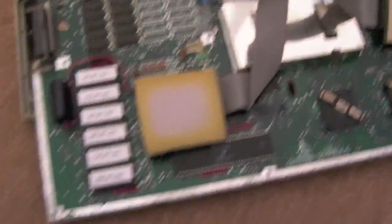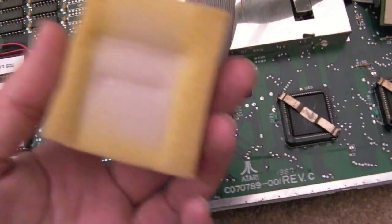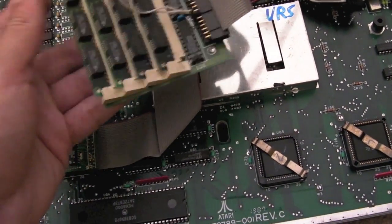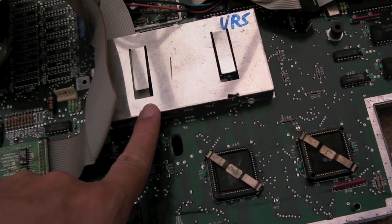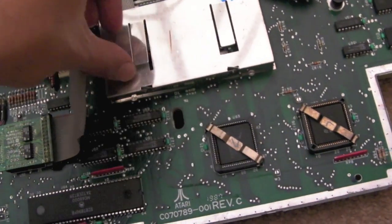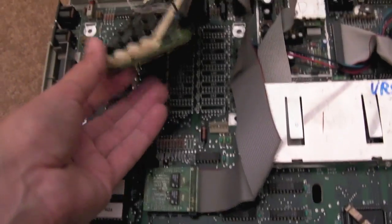One of the first things you'll see is this sponge padding I've put in, which sits nicely under the metal shielding. This is the Marpet — you've got a couple of buffer chips that connect to this PCB, and this PCB has more buffer chips and four 1 meg 30-pin SIMMs. Another ribbon goes to the video shifter chip, because certain address lines needed are inside the MMU chip — a DIP-40 in a socket. You pull the chip out, stick this little sub-board in, then put your original chip back in. That's how you get the two connections and add 4 meg.